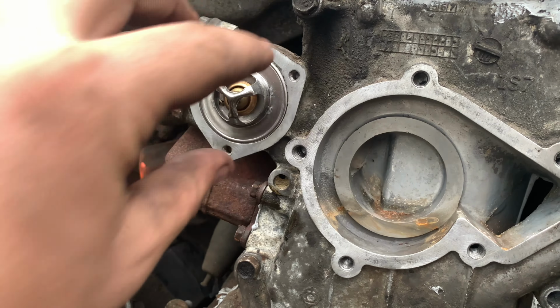Well, good morning, guys. We are back out here. Fun day. It's raining. I'm loving this. So instead of untarping the engine right now, because it is raining and I'm trying to prohibit water from getting into the engine, I think I'm going to bust open the garage and try to run something out here, some sort of drill, and we're going to start drilling out the spot welds that hold the radiator support in so we can get this right out of the way.